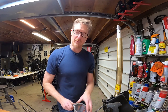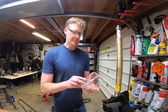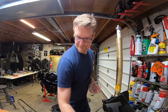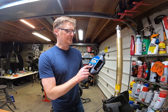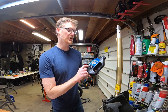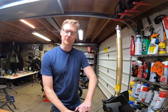Okay, she's gone. So anyway, as I was saying, this is motorcycle specific Pyrex, you know, typical specific for the shop. And I will be using today the Maxima fork fluid. This is the 5 weight, 85 to 150 anti-stiction racing formula. By the way, this has basically the same viscosity as the OEM fluid, which is why I'm using it.